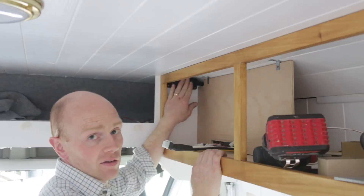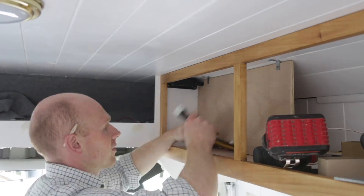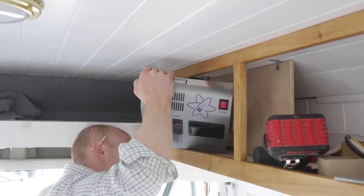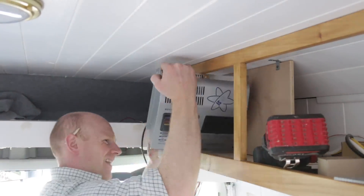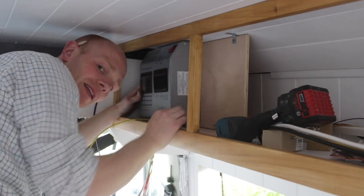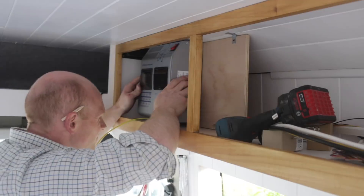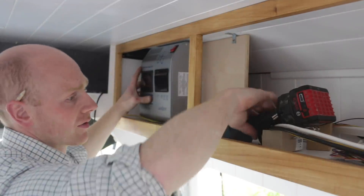There's a cut-out for the negative bus bar and a cut-out for the solar when we get around to doing that. The negatives will just come through here and loop up — there's plenty of space. Now I'm going to try and get this system in so I can at least get some 12-volt running. I want to make sure I leave as much clearance as I can at the top there for ventilation — most of it's at the front but there is a tiny vent at the top. There's enough space there for the solar charge controller. Right, let's get this thing on the wall.